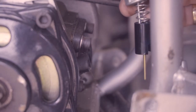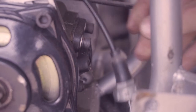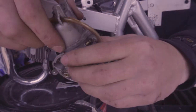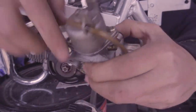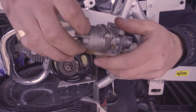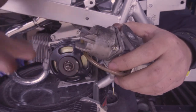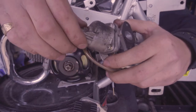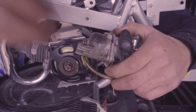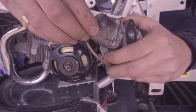This is actually a decent quality carburetor that just wasn't properly cared for. Pull it out and that's your throttle needle — carburetor needle, whatever you want to call it. At this point your carburetor is off. You could open up the bowl, clean out the jets, spray some carb cleaner in there — or don't waste your time and just order a decent carburetor from Chinese Parts Canada or another quality source, because the Amazon and eBay carbs just don't work.